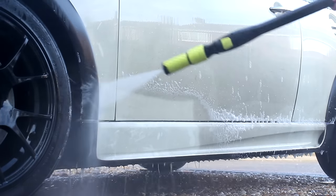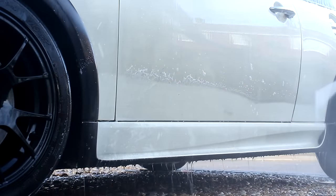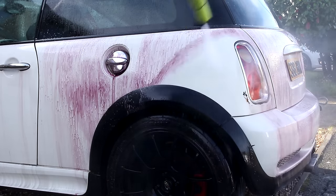Same when it comes to pre-wash. The question is: do you look at the car, knowing it's been around a track, and just go straight in with a fallout remover? Or do you do the usual steps and give the chemicals a chance, then go in with your pre-wash — a very, very strong pre-wash, like one-to-six decon shampoo? Paul from Detailing Reviews turned up and said he could smell it from here — it was that strong. On the front of the car it stripped everything. But as you know, brake dust gets dumped on the sides, goes like a vortex up the sides and around the back. One thing I didn't show you — the door shuts, where the crease comes down from the lock mechanism — that started rusting up. Not bodywork rust — it was all the brake dust, just encrusted. So I ended up putting fallout remover in the door shuts; it was that bad.